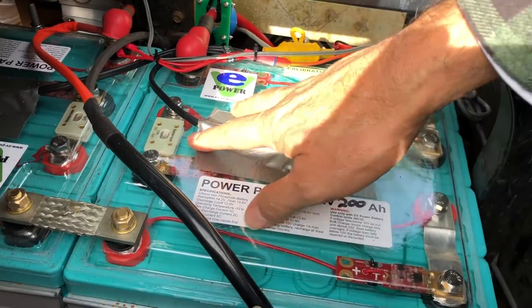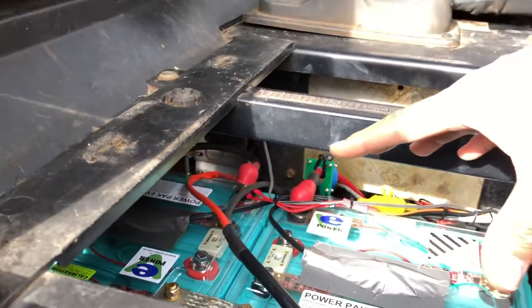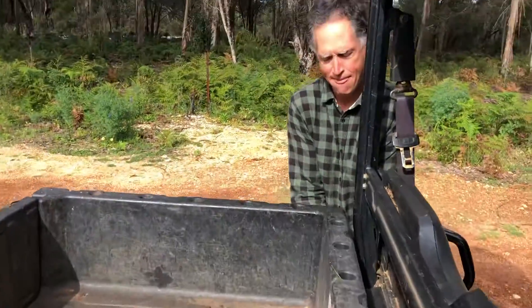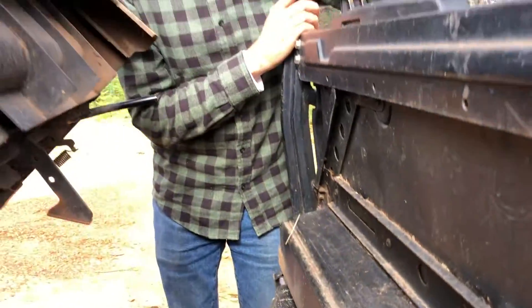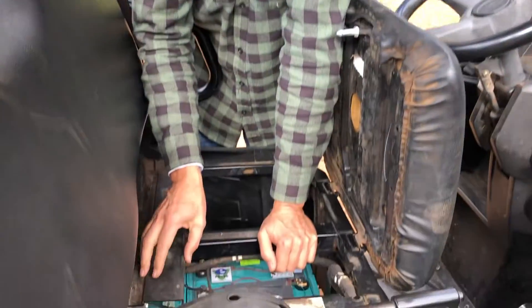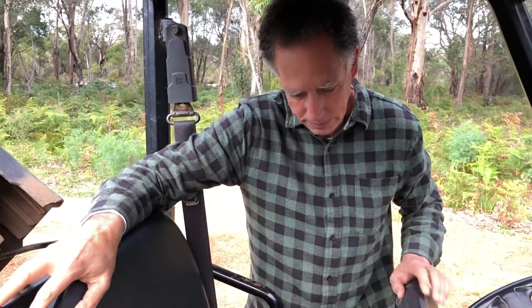You'll notice a bit of gaffer tape — that looks agricultural — it's just to protect the tops of the batteries. The Polaris is so open under here that I consider it to be a major design flaw on Polaris's part. With lead batteries you're supposed to have ventilation, but this is crazy — almost every surface is designed to tip water and dust in. You've got wheels kicking dirt into the battery box, so we plugged it up with foam. Even the seats — any rain gets in here and tips straight down on top of the batteries — so we sealed the tops.